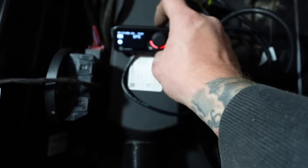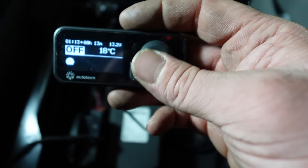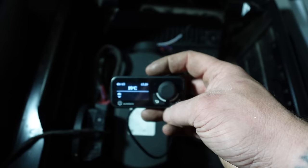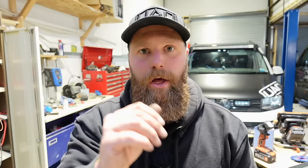That is another common mistake. With all our jobs done, the only way to turn this unit off is to turn the knob until you see the word 'off' and select the off position. The fan will ramp up and then run cold for a short time during the ramp-down procedure. Do not ever turn your diesel heater off mid-cycle. Also ensure your power supply is sufficient - these can draw around 140 watts, which is about 12 amps, during ramp up and ramp down. While running normally you can look at using about 30 watts.